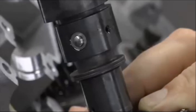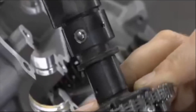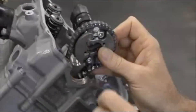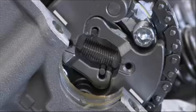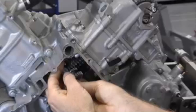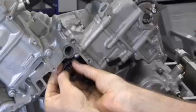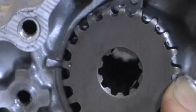The rear camshaft is marked with a groove to distinguish it from the front camshaft. Install the rear camshaft and camchain together into the rear cylinder head. Let the chain drop down to the crankshaft. Time the camshaft using its horizontal marks. Work the camchain onto the subshaft sprocket while keeping the camshaft timed to the cylinder head and the sprocket timed to the crankcase mark.